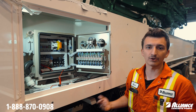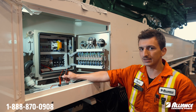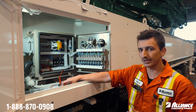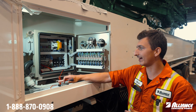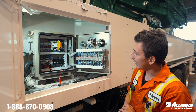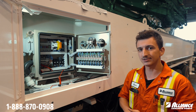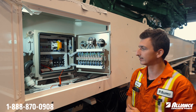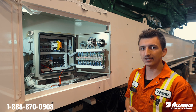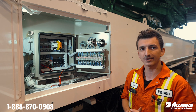The same thing goes for all of these columns and all of the troubleshooting — some might not be power, some will signal a ground. Use the diagram that comes in the panel as a reference. If you're troubleshooting, it's a great tool to have and I recommend using it at every possibility. That's troubleshooting an ice cube relay — pretty simple. They go bad, so this should save you some time if you memorize how to do this and learn the system. That's all for this week — thank you for watching, and if you have any questions or ideas, let us know and give our service department a call if you need anything. Thank you.